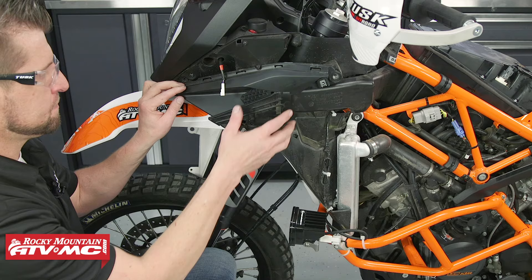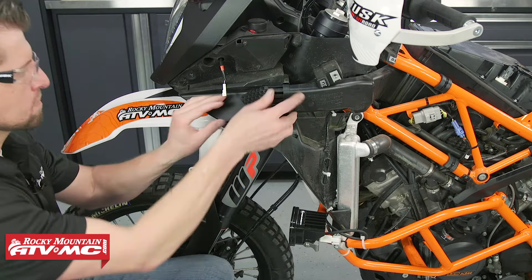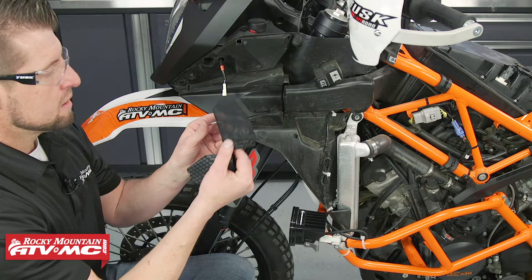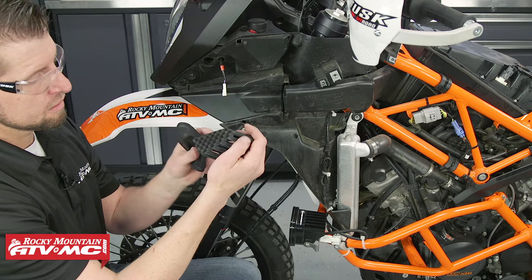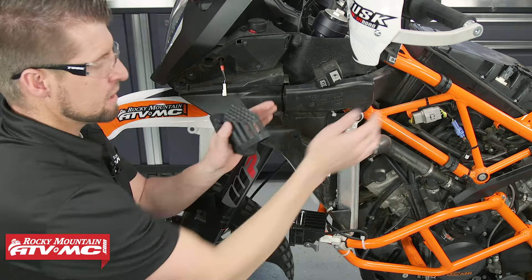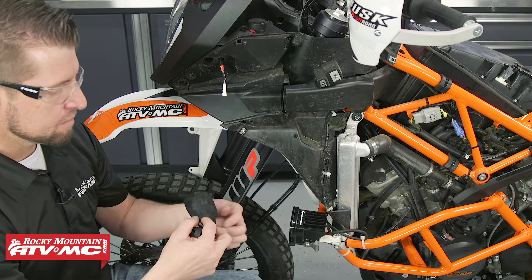During this process, be sure to inspect the intake screen. These filtration socks are really nice because they'll stop any larger debris from traveling through the screen that goes along this intake duct into your air boot — it's kind of like a pre-filter before the actual air filter. They're pretty inexpensive and they go a long way, so they're nice to have.